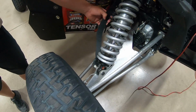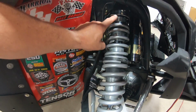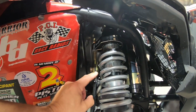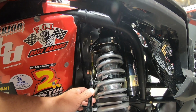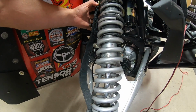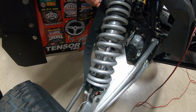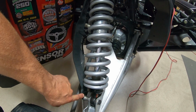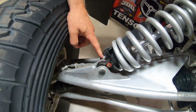So if you look at this race car, you've got the strap tether holding onto the spring, you've got the overall strap mount and clevis. You notice this is loose. Well, that's designed to be that way. We want the straps to ride inside that clevis fairly loose so that when the system is extended and this gets tight, it pulls this perfectly straight. Because if the ends of the straps are crooked sideways when it goes fully straight, it tends to cut the strap. So you want to make sure that these tabs on both ends are always straight when it's got tension.